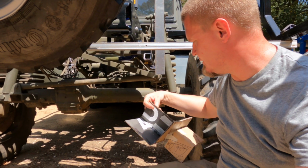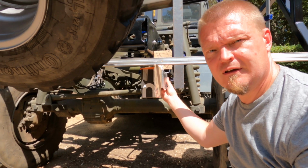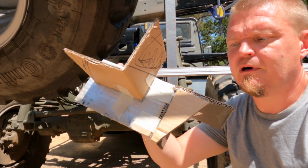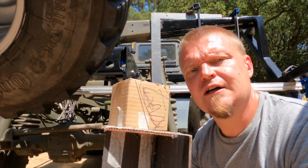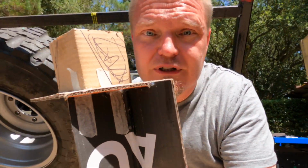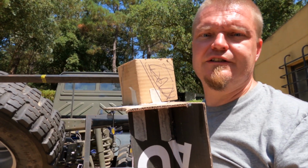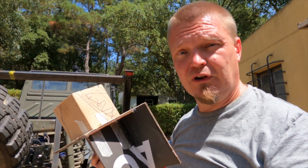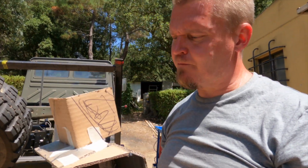and the idea is that this one will go up there, and I can't really show it to you until I start trimming it off, but basically this is 3 pieces of angle iron welded together, not trimmed, and then a flat piece on the top there. And I have hot glued this together, which also gives a little indication of whether this is strong at all. If this would be super flimsy, then the end result in steel would also be super flimsy, but luckily it has got a little bit of strength.